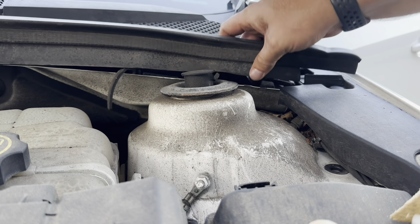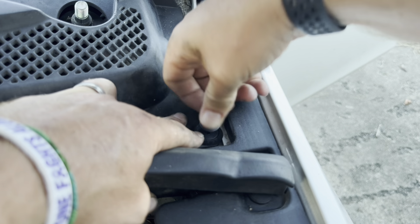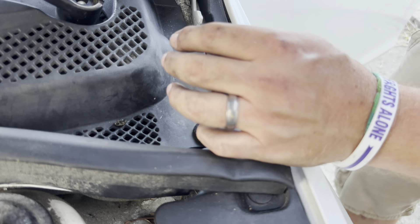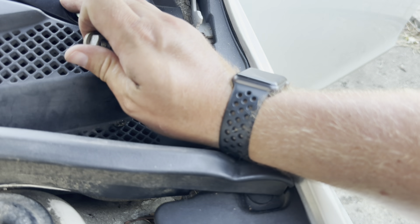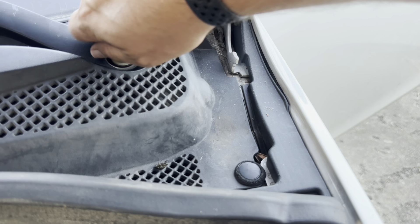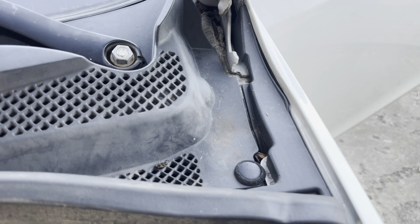To put it back together, pop this back down into place. Put the base in, push it all the way down, then take your key — whatever you want to call it — put that in and that secures it. Then we have the windshield wiper, which comes from the outside. Place it where it would be at the start of its arc — you can tell by looking at the windshield where that line is. Get it lined up, spin on the nut while holding it in place with the other hand, and once close grab the socket to tighten.